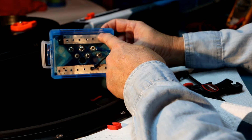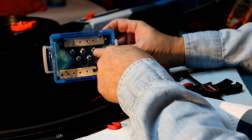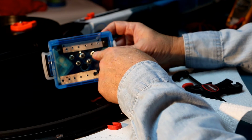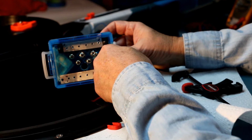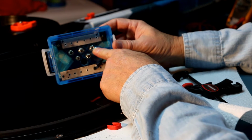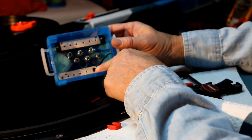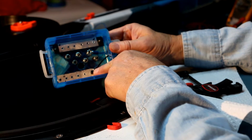So whenever I turn on switch 1, it will put plus 5 volts to the plus 5, I keep saying plus 5, forgive me, that's plus 12. It will take my 12 volts, go through the switch, put 12 volts here on the blue wires going to my LED strips, and through the LED strips they will be terminated here through the ground. So that will complete the path, and therefore they will light.